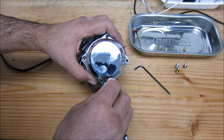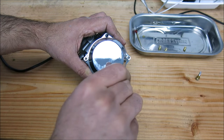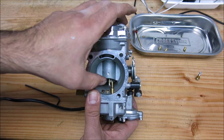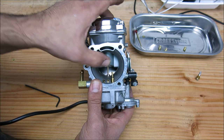Here are the 3 millimeter hex screws I'm going to use instead of those horrible Phillips that come from the factory. Put all those in position finger tight first, then a little bit more with the tool. And that's basically it. We can see the slide now moving freely — nothing's holding it, nothing's latching anywhere. It's coming down by force of the spring, which is a good indication that things are going to work. If you have compressed air you can actually check it, but I've done it so many times I'm confident it will work fine. And that's basically the whole installation.